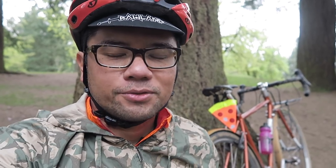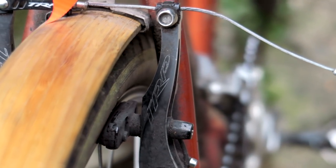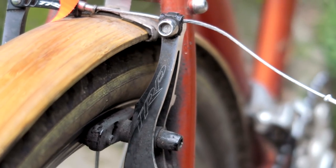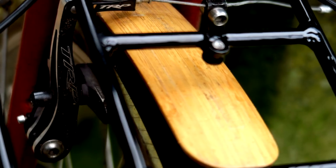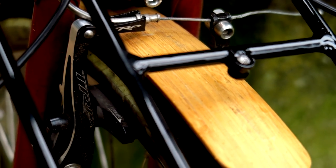One of the first things I changed were the brakes. This version came with a Tektro cantilever brake, and since I was never a fan of cantis I swapped them out with TRP short pull v-brakes. These are popular with cross racers and vastly improved braking power, but the braking was fairly binary — either all the way on or off — making it tough to modulate.